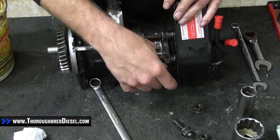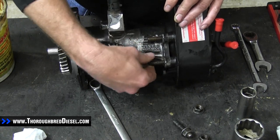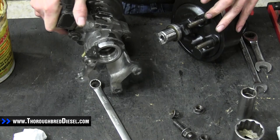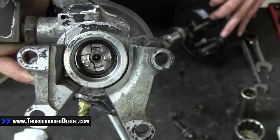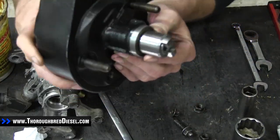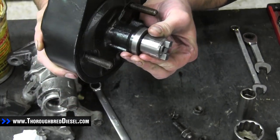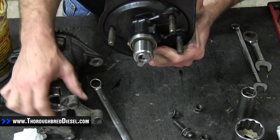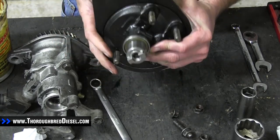Make sure you take your time and do this correctly. Taking our power steering pump off — just the four nuts and it'll come out. The studs may come out; don't worry about that. You can see inside the vacuum pump there's a little cross female drive section. On your power steering pump, on the end of the pump, there is a drive dog that slips onto the shaft, that's pressed on the shaft. That goes into that cross section. As the engine turns the vacuum pump, it's all connected in that four-way section and it drives the hydraulic pump or the power steering pump.